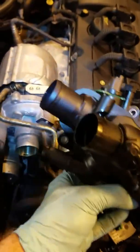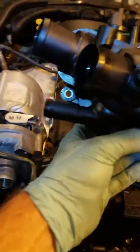Right. Okay, here's the new water pump we're going to be installing here. I have yet to unbolt this yet. I want to show you where the bolts are, and there's 3 bolts that go in here. So it sits like this. The brown connector's up top, which is similar to the brown connector that sits right up in that spot right there. So you have one here, you have one down underneath at the bottom here, and then one over here under that tube.